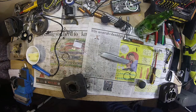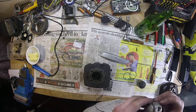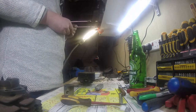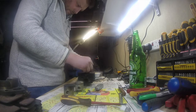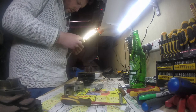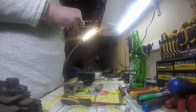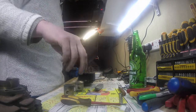Just honed that out. Which of these pistons looks better? That looks quite nice even dirty. I think we'll fit this one — it looks the newest of them all. I wonder what the ring gaps are like on this one. Let's check the rings. Because I'm nothing if not a skinflint, I wouldn't mind keeping these — they're good as well, we've got to have good spares. Oh, they're really good — these are brand new as well. They look hardened. I'm going to run these off that piston, clean it up and run those. Keep these brand new ones for another time — never hurts to keep them.